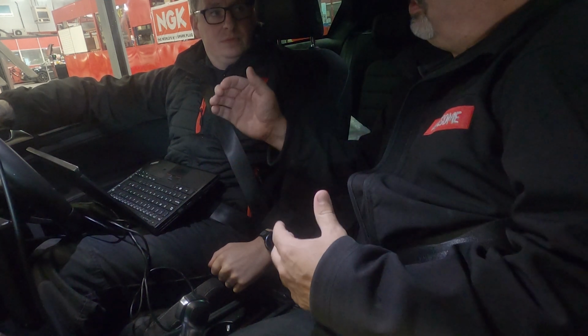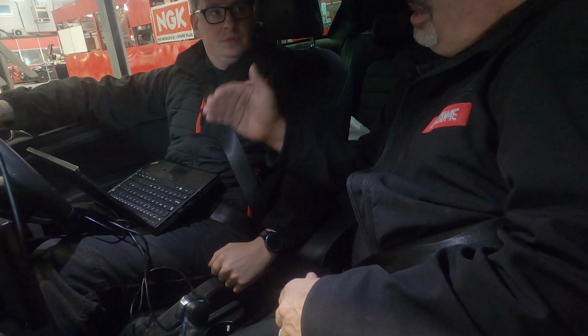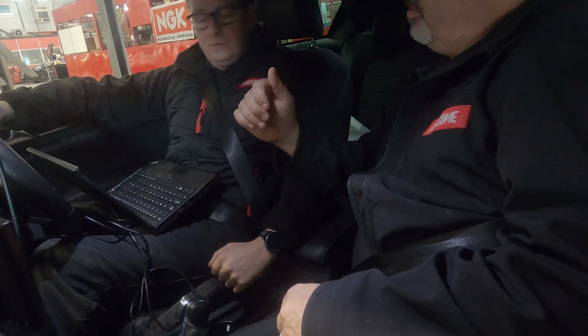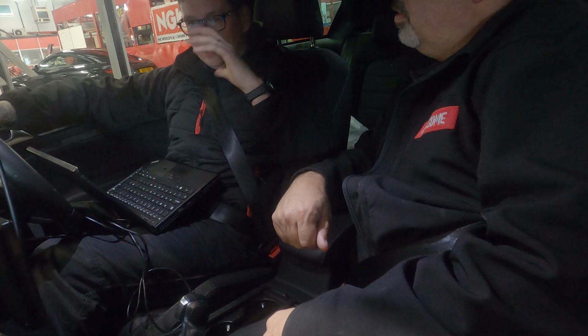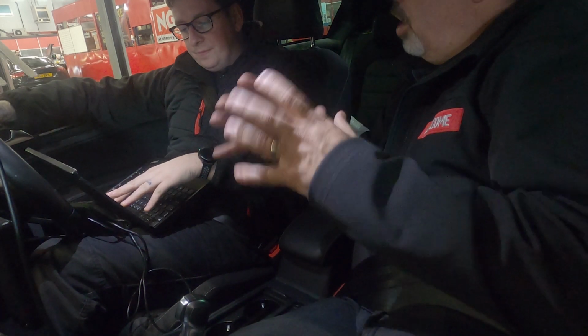We're obviously going to run the car on its stock. So what is it that you're actually checking for whilst we're running? A few of the things we're going to check: the timing pull, stock form, and the boost pressure via VAGCOM. That'll be an issue afterwards. We wouldn't be able to check that via VAGCOM just because the box is giving false readings. So that's one of the bits that you can't check.